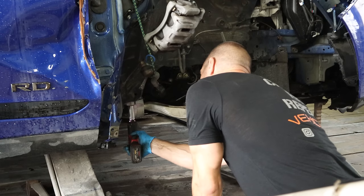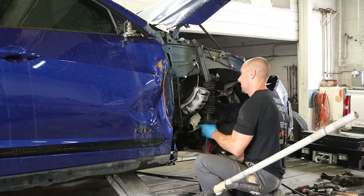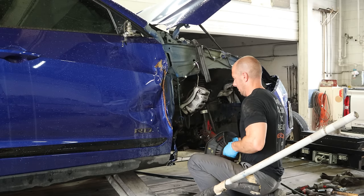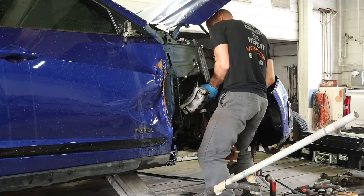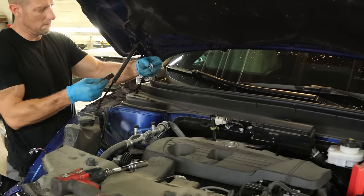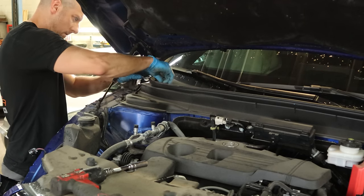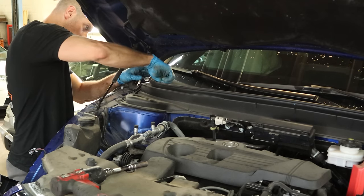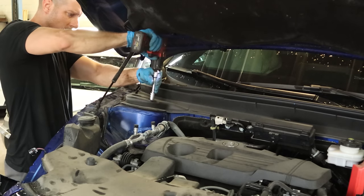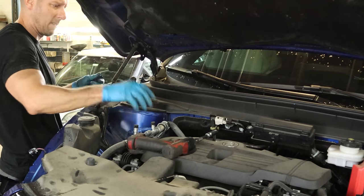Once the bolt is tight enough to pinch the metal part of the bushing in there, you can push down on the control arm and the rubber will just twist without moving that metal part. Then we'll tighten up our one last bolt. Now we can throw our suspension up in here — I left it all together, no need to take it apart. It's everything: the strut, the knuckle, the hub, the backing plate, even our ABS wire. To avoid losing these nuts to Narnia, we're going to use a magnetic socket to get them started. It's not long enough to tighten them all the way, but enough to get started, then run it down with our impact and regular socket. And we can put our little caps on there.